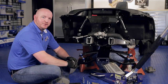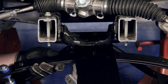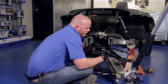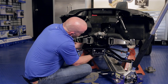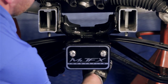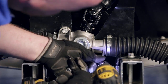To attach the new lifted front suspension, we're going to take our old spring plate that we retained from earlier, place it under the lift kit, and then attach using the 45 millimeter hardware provided in the kit. A floor jack or extra set of hands are helpful to hold the lift kit in place. Make sure to use thread locking adhesive. We can now reattach the steering rack using the retained hardware — once all three bolts are in place, then tighten.